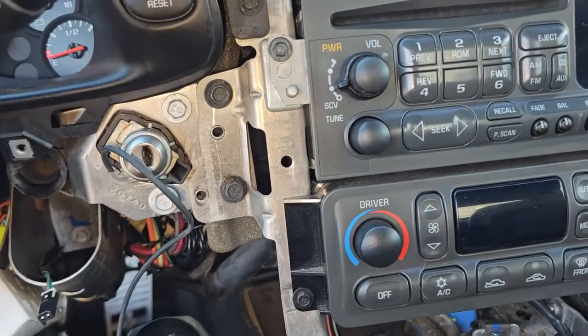If you wanted to get really fancy, there are two other ways to do this. Because of trouble with my daughter's Corvette where the BCM is basically fried, you could also go down to the BCM and slice into the wires coming right out of the BCM and put the resistor there - that would eliminate any possibility of a bad connection anywhere between the key and the BCM. Or, if you wanted to get really thorough, you could actually take the BCM apart and solder the resistor across the contacts inside the BCM on the actual circuit board - that would be the absolute ultimate with no bad connection risk. That's probably something I'm going to do this winter. But that's how you bypass the VATS system to make sure it doesn't strand you. Thanks for watching.